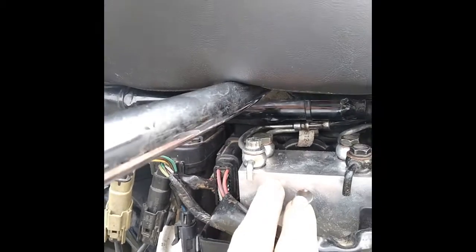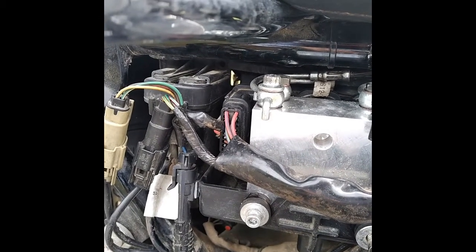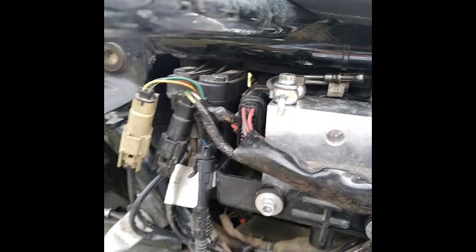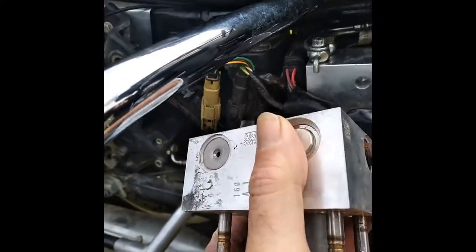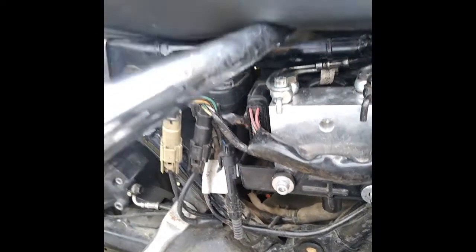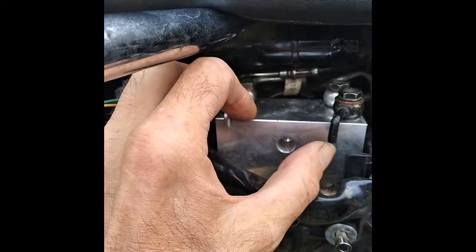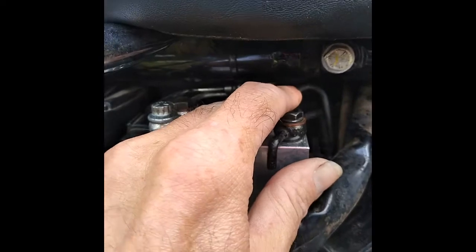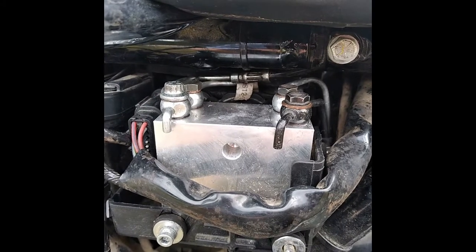There are four valves in here. It locks those valves in place — they get stuck from moisture in the brake fluid or whatever. You've got your front side on the back here, and it's labeled. It says F and MF — master cylinder front — and front brake line. Then the rear is on the right side here, labeled the same way except it's rear: master cylinder rear and rear brake.